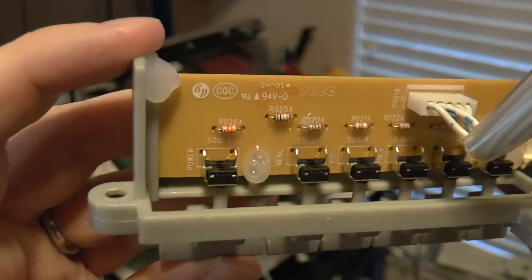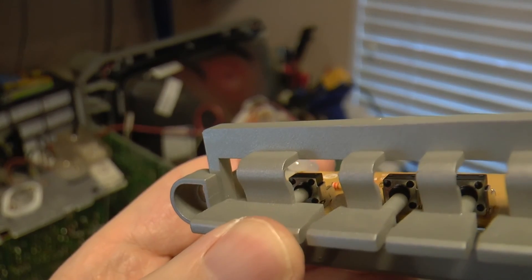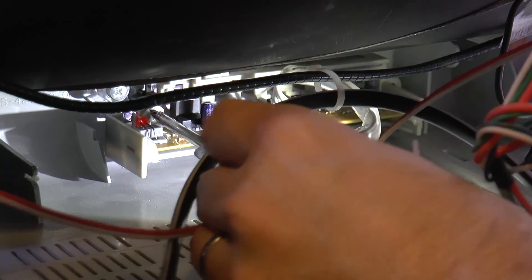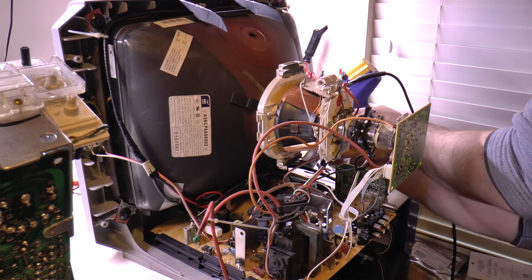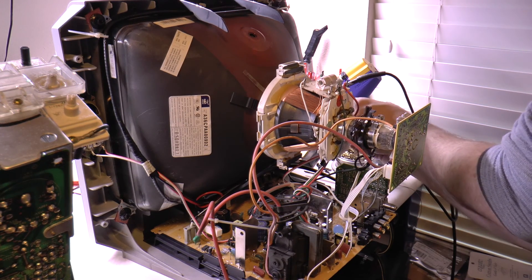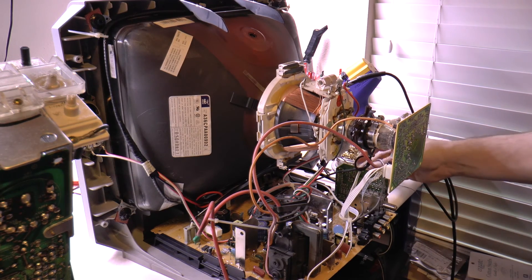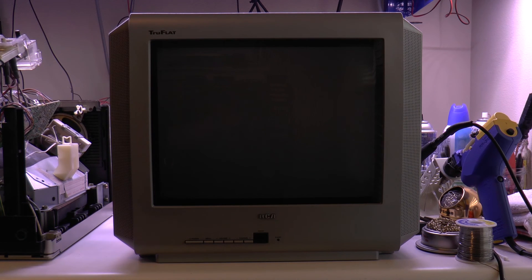Already, the tactile response from the front buttons feels solid. The shell is ready to be mounted to the front of the set again. Three screws, guide rail snapped back into place, reconnect components to the primary PCB, the front board, power cord, RGB and 200 volt signals to the neck board, deflection wire, speakers, degaussing coil, flyback transformer — everything. And finally, we can test.